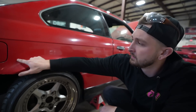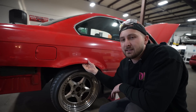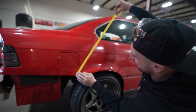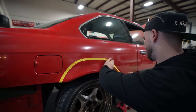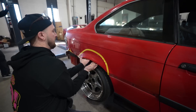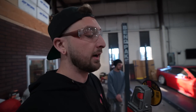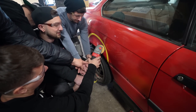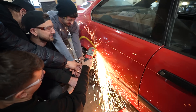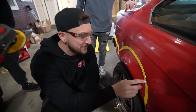We're going to cut this uniformly - cut the outside skin off first, then utilize the inside skin to actually seal it up. You hold the grinder up high, get a nice line. You can feel the shape of the inside arch and you just have to match that. First cut on the car - I can't be the only one with blood on my hands, so let's do this together. On three... go! That's it. No turning back now. First cut is officially made.